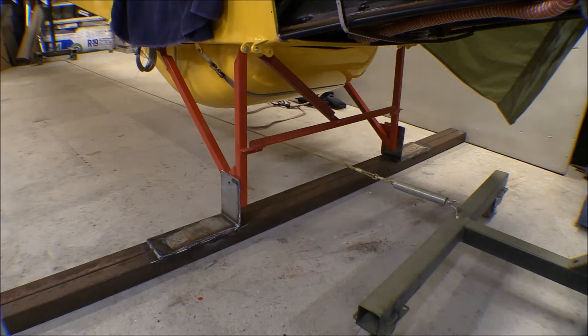It's going to stick out quite a ways either side — I'll probably stumble over it a hundred times — but it's not as obtrusive as a set of landing gear with big tires or floats would be. It's going to keep the airplane at a reasonable height to work on the engine and the wings until we get those done. We can also jack it up and block it up. I'll have to make something for the back end to jack it up, because we have to level the fuselage to rig everything properly — the horizontal stabilizers, elevators, and all of that stuff.